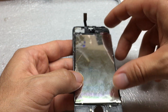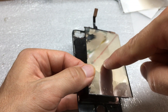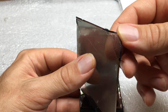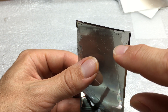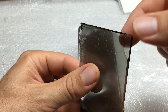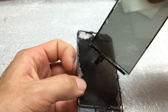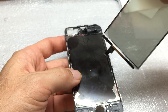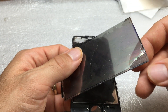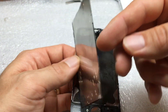Now we are at the final stages of our dig. This piece I'm touching right now is the back polarizing film — you can see it right here. This plasticky thing that broke off is the LCD itself, with the capacitive touch sensor in there. This piece right here is the rear polarizing filter. I'll do another video that shows a demonstration of how the polarizer works in an LCD — in this case an iPhone screen.